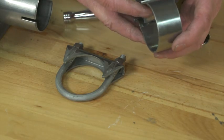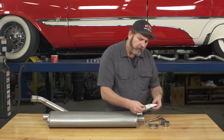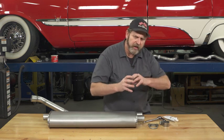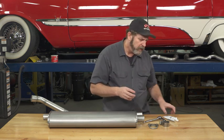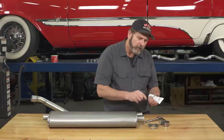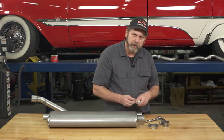These two exhaust clamp styles are the most commonly used and available. Another helpful quick hint: when assembling exhaust pipes, especially in a new system when you're trying to fit things together, stuff will want to fight itself together and fight itself apart. Using an actual exhaust sealant in the pipes will actually allow you to remove and assemble them easier, and once it's there, it provides a better seal.